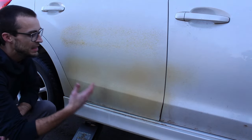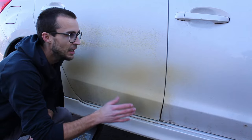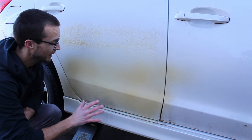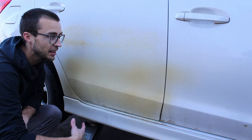As you can see, the gun gives a much smoother, more even coating. The can gives more particle splattering, while the spray gun coats a lot faster and more evenly. You're going to be able to do a car way quicker. I did it on the outside just so you could see it better.